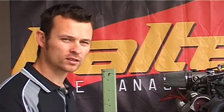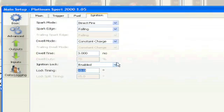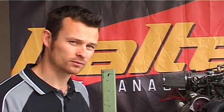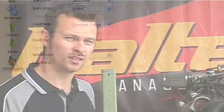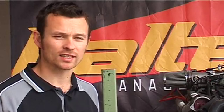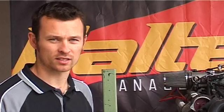What this will do is tell the computer to always fire the timing at 10 degrees — though it doesn't have to be 10 degrees; it'll be whatever angle you have set in the lock timing angle. So if you only have a zero degree mark on your timing pulley, set this to zero degrees. If you have a 15 degree mark on your pulley, you can set it to 15 degrees. Whatever it is, this process is just used to synchronize the computer with the engine.